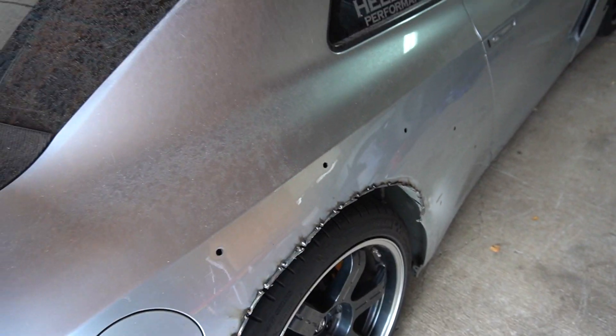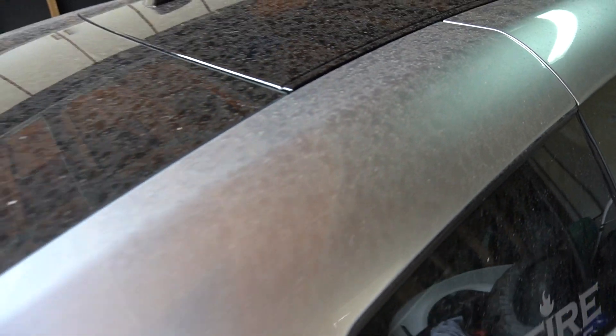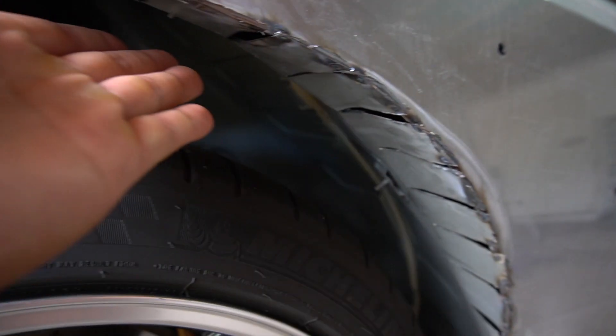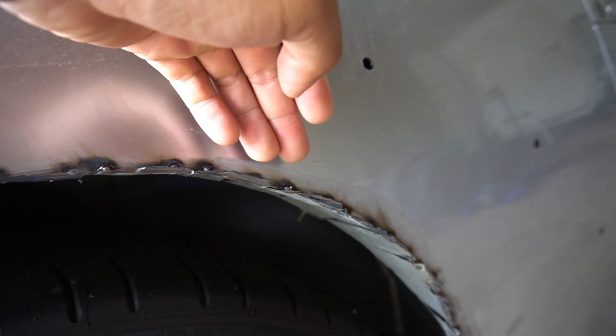The biggest challenge for us was to get everything fitted and then cutting the fenders. From there on, honestly it's just all the nitty-gritty stuff. So what we're gonna do today is we're gonna seal up the rears because we do have some openings from the relief cuts. We kind of have a little edge on all the relief cuts, but as we bent it forward we create some gaps in between right here and it goes all the way around. We're gonna be using fiberglass underneath to create some sort of a barrier, and then on the top side we're going to be using the caulking seam sealer.